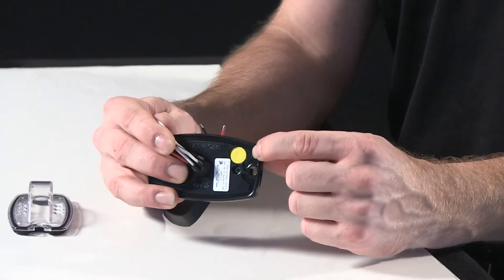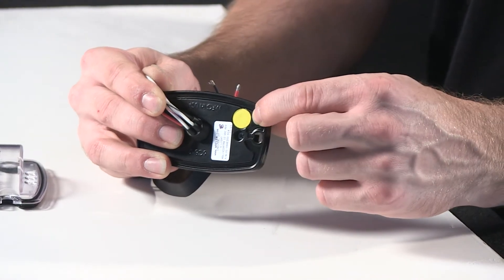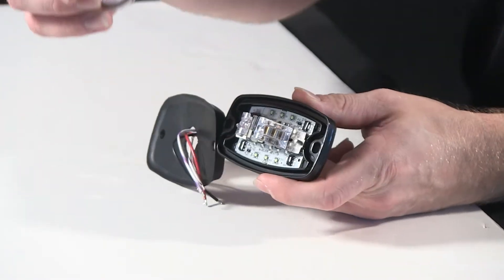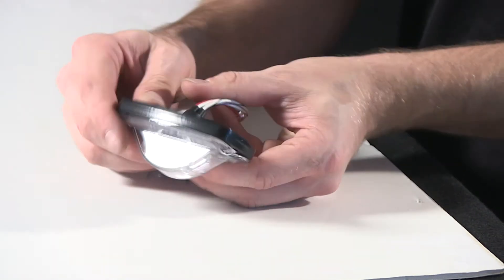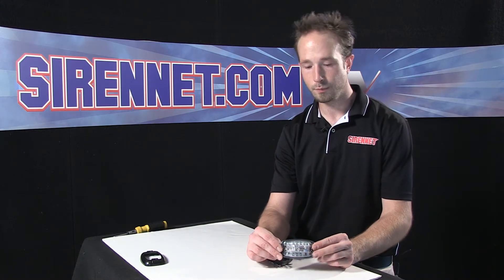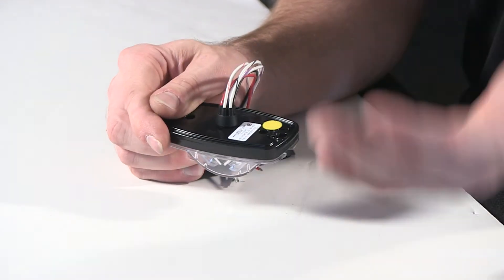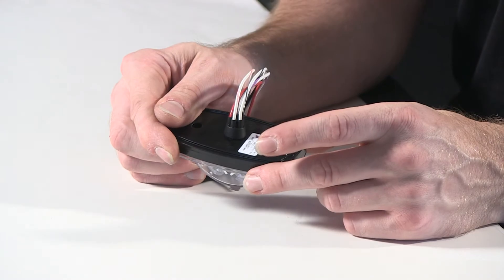On the back of the V-Series, you'll notice a yellow sticker — it's actually what's referred to as a Gore-Tex breather. It covers a hole drilled into the housing of the V23, acting as a pass-through for air. When the unit has the lens resealed on tightly, condensation that builds up inside will escape through the rear breather — when it goes from cold to warm, or when you turn on the lights and the unit gets warm inside. The Gore-Tex breather is a one-way unit: it lets air flow out but not back in, so it keeps condensation out. No worries — it's not going to fill up with water.